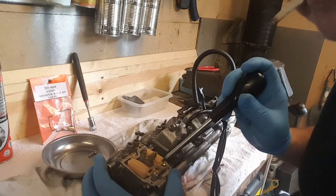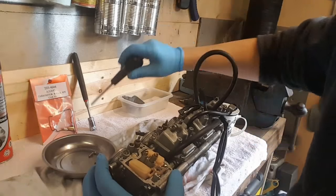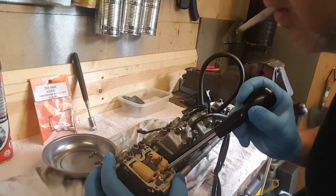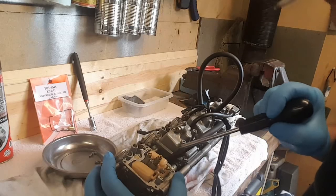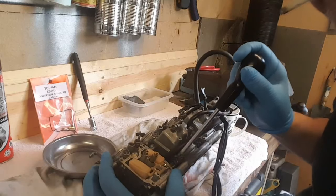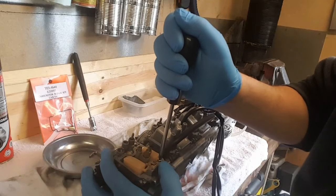Just gonna check out the orientation of the needle. There's a sort of springy clip on top of it, and it goes with the two little butterfly shaped things on the clip, and they go face that way. And this float is held in by this brass coloured screw,